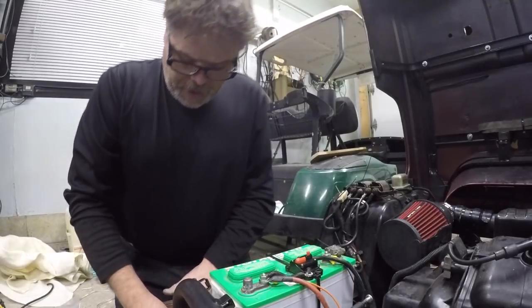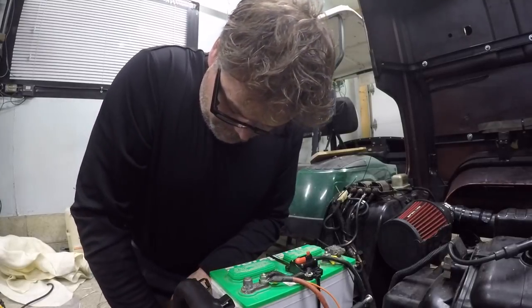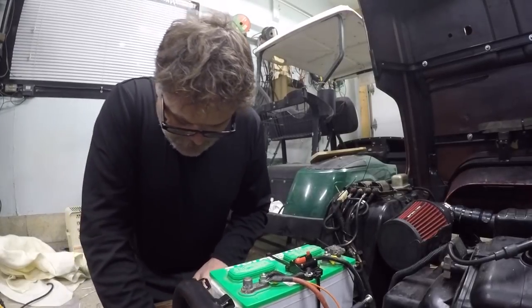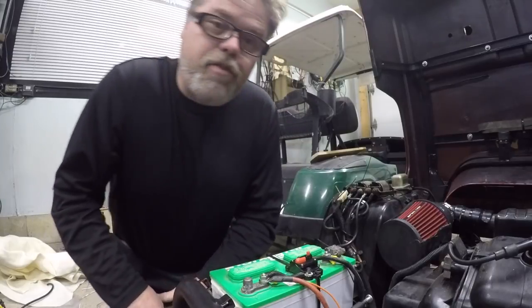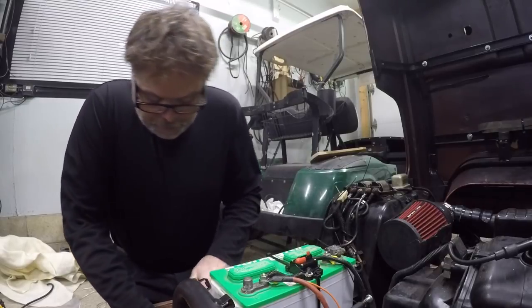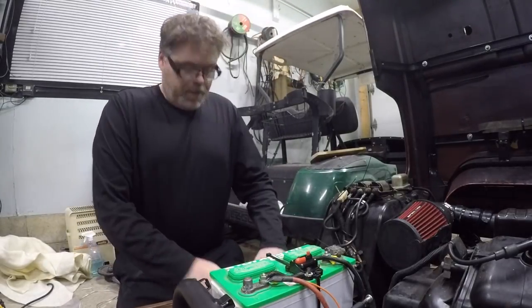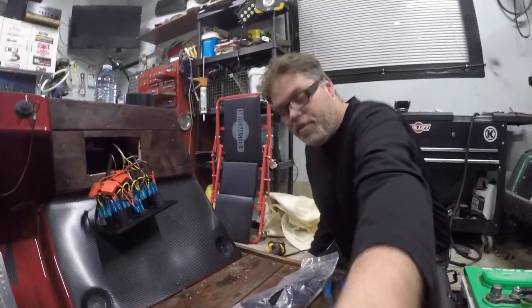And we'll hook that up because it's cheaper to do it that way than buying an alternator generator - because the alternator generators are about $700 boys. So we're gonna do her that way and she'll be safe. Because you can't hook up 16.7 volts to a stereo or it's just gonna fry it, and LED lights and whatever else. If I'm just idling around she's fine, but if I give her some throttle she goes right up to 16.7 boys. So she's making some juice, she is.